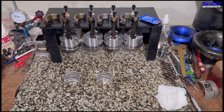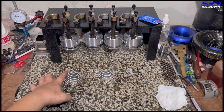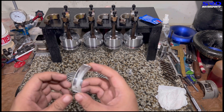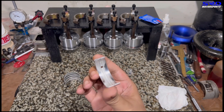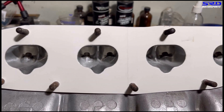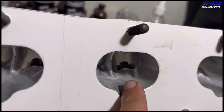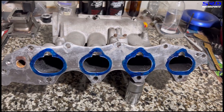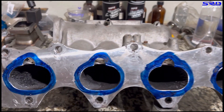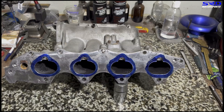In the earlier episode, we talked about how the brand new bearings the previous builder used had unusual wear. We also found the crankshaft needed micro polishing to get the necessary clearances on the mains and rod bearings. So we sent that to the machine shop. While waiting, we finished the cylinder head and cut an intake gasket that matches perfectly on the head. As you can see, it's cut exactly like the intake ports so we can port match it into the manifold. After scribing the line based on that gasket, you can see it's slightly off on the roof and on the left side, so we've got to cut the plenum to port it all the way through.